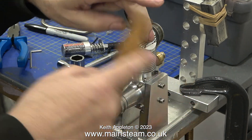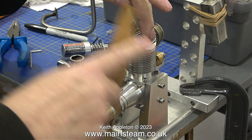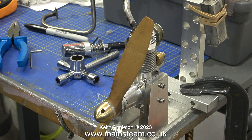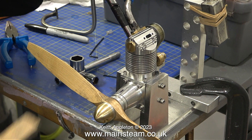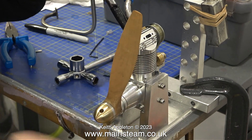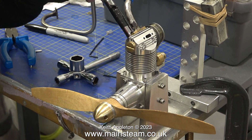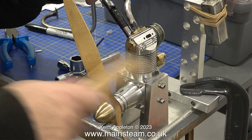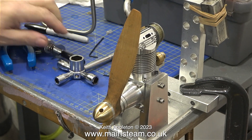Is there an air leak around the top of the cylinder liner? There could be, but there's no oil showing around the top of the cylinder itself. Almost every one of the small aero engines in my collection has a sealing washer on top of the liner where it meets the head, but this engine does not have a washer in this position. I connected the glow plug and there's definitely fuel going into the engine — the line from the tank is full of fuel with no air — and as you can clearly see, it doesn't work at all.